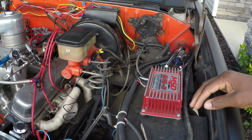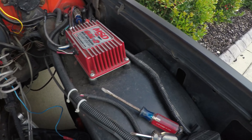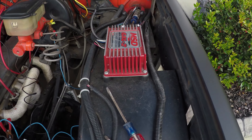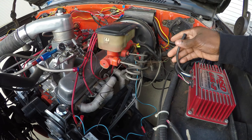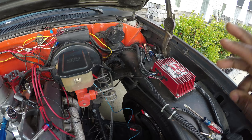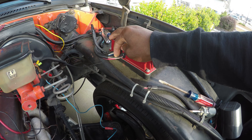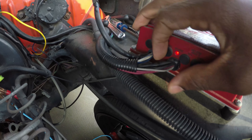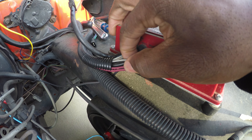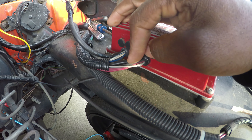But I'm just going to show you here how to quickly test your MSD box if you're trying to isolate and figure out what's going on with your vehicle as far as the no spark. So what you want to do is isolate the MSD 6AL circuit — plain and simple. Three wires you're looking for: you got your two reds coming out of here, and you got your negative coming out of here. The thicker red wire is your constant 12 volts, your smaller red wire is your switched 12 volts, your black wire here is your ground — and that's all you need.